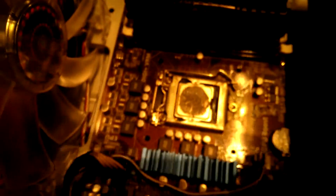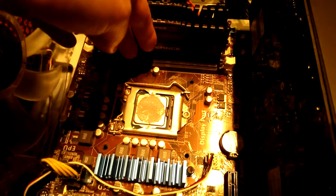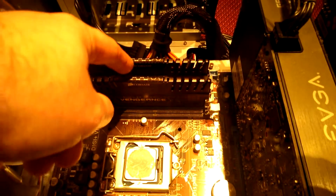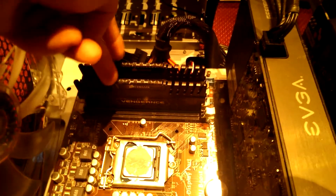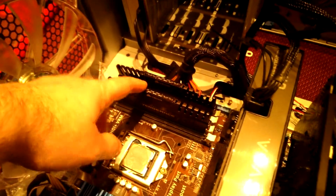105 Celsius is really overdoing it. I'm pretty happy my CPU isn't dead. I've got Corsair Vengeance RAM in there and I'm hoping the heat sink isn't too close to it — I might have to move this RAM up a slot, which isn't ideal. You're supposed to have them in these two slots for the best speed. If I really have trouble I might have to change the heat sinks or change RAM entirely.